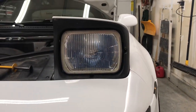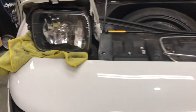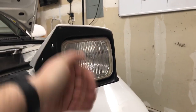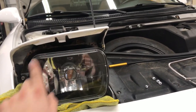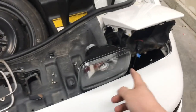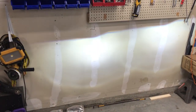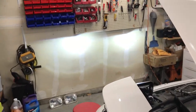See how much better it looks — the old dingy headlight versus the new one. Those little lines on the old lens are why I recommend buying the clear lenses: you want the light to shine through as well as possible. Because the LED has a cutoff line like a projector, you don't need the lines to prevent blinding oncoming traffic — so the clearer the lens the better. With both headlights plugged in, low beam works but high beam does nothing and you have no fogs. That's what I meant by needing the harness.